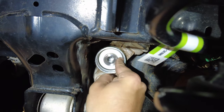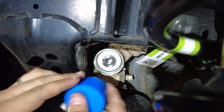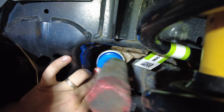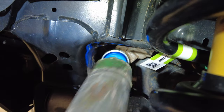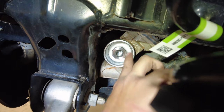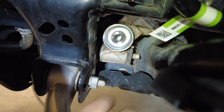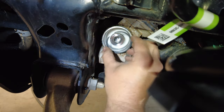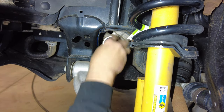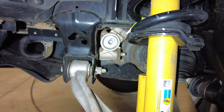Get your bushing slid into place and you'll feel when it locks into that oblong side. Then simply take your install tool and give it a few whacks. When you hear the sound change, you know you're all the way seated in there, just like that. See how we got just a fine little strand off that o-ring - that's normal, that's okay. Now all we got to do is put our snap ring into place, tap it in with the install tool, and just like that your snap ring is seated into place so that bushing can't potentially come backwards.